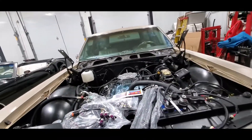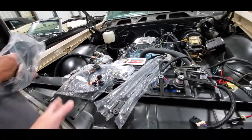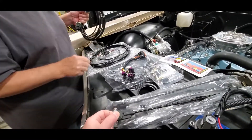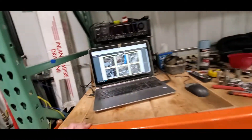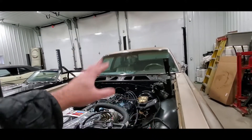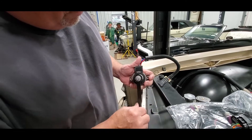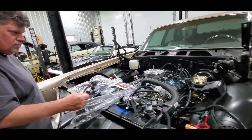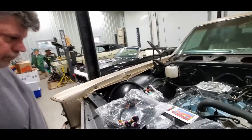The other big thing is we've figured that especially with the gas tank and people getting in and out, we have to have a level system. Here's $500 worth of potentiometers to help us do some leveling. This will be a big chunk of what we're trying to figure out today — how all this works and how we want to set it up. Once we get the spring back in we can get everything to height. The hardest part is making sure we only use within the window they want: things can't get hit, not in the way of anything, tires don't touch them, rocks off the road don't break them.